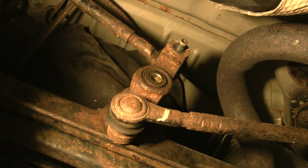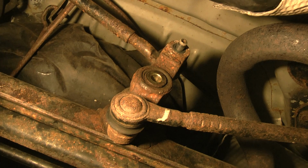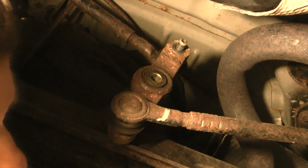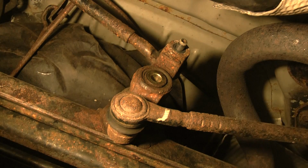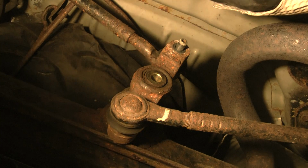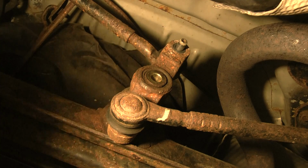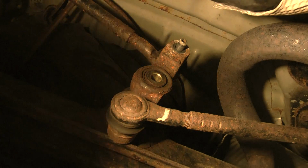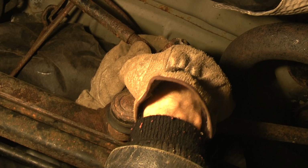But anyway, there's probably a Morse taper. It's two surfaces that are just a little bit off of each other, like maybe just a degree, something like that. So when you snap them together, they'll snug fit. That's what a Morse taper is called in the machining trade. That way you just slip this thing up there and it stays. I do believe that's probably the same principle as the Morse taper.